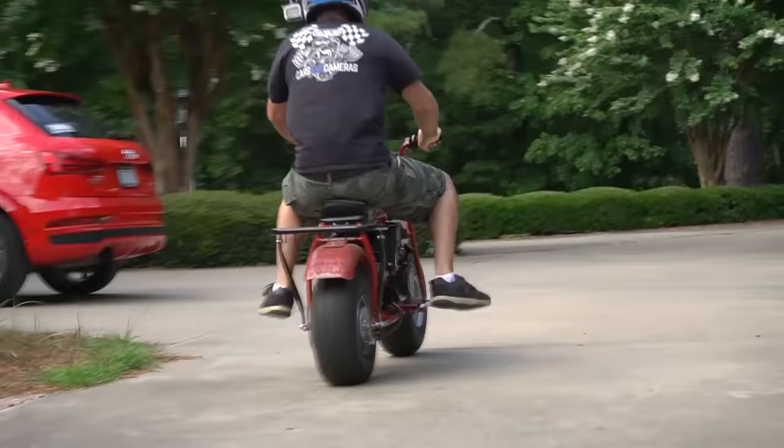We need to start by taking the muffler off. Maybe a little bit of finagling. Hey, look at that. All right, so the kit comes with a nice new exhaust gasket. Make sure the flange sealing surface is clean, free of debris. You talking to me or the people? The people. Maybe both. Is ours clean and free of debris? Okay. And there's the header.